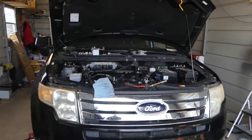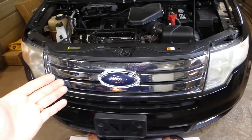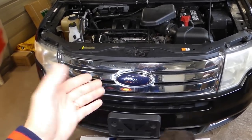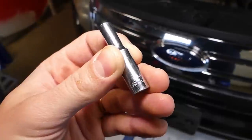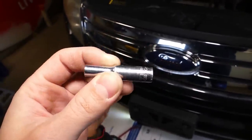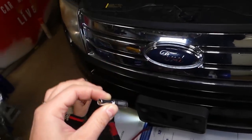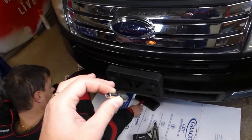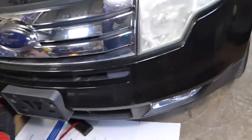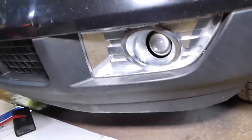So let's start on it now. All the tools and parts that are used in the video will be listed in the description of the video below. First thing that we'll be using is a 7 millimeter socket. I don't know which metric that will be, but this one fits the best on the screws that we need to remove. There is one cover underneath that we need to remove with that socket, and then we can get to the drain plug.